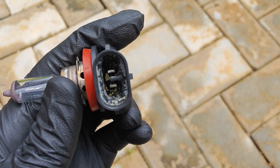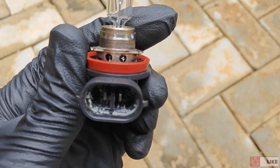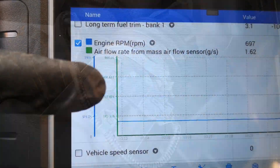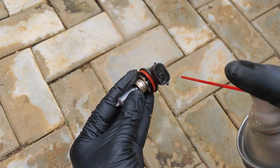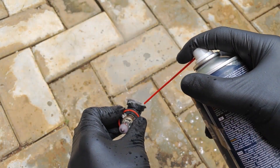To bring this message home, check out the connector or the prongs on this headlight bulb — you can definitely see that there's some corrosion buildup here. Just imagine that with your MAF sensor, and it builds up to the point where it begins to interfere with communication with the ECU — that's definitely going to give you codes. Simply cleaning with electrical contact cleaner may be all that's required to turn off the check engine light.